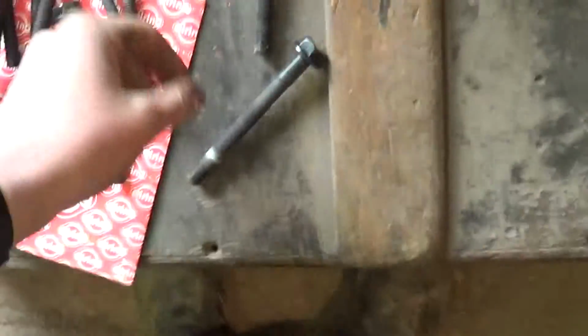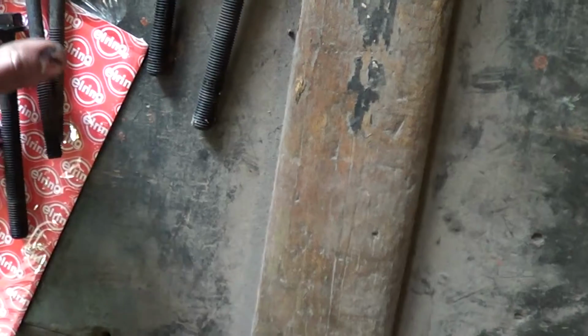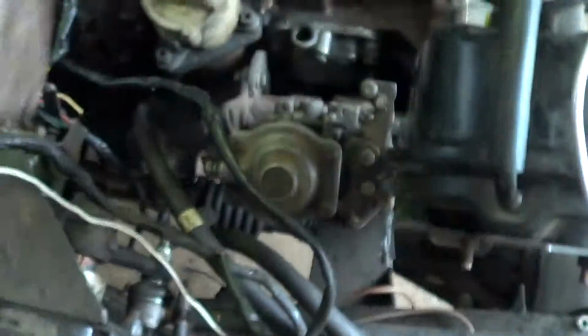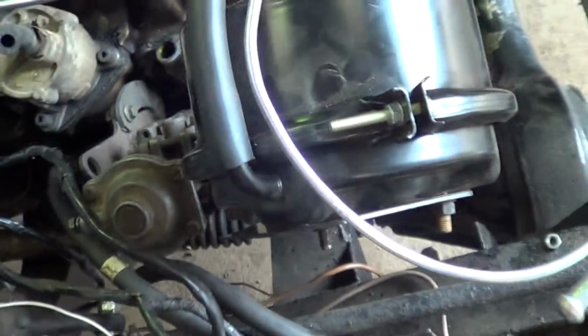Well, I'm just putting the cylinder head back on. When you're doing this job, you've got three bolts to choose from, basically. You've got that one, that one, and that one. Three different sizes. This size goes in the main two rows there. Four of these go along here. I'll just drop that one in place while I'm at it. And then this one, number three,